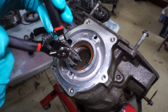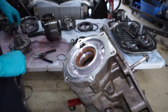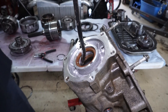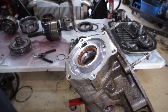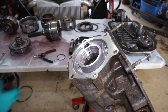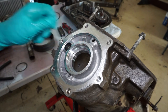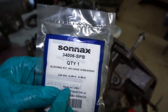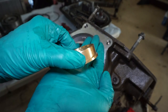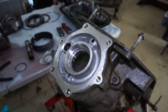All right. First thing I'm going to do with the case is do this rear seal. I got a big snap ring in here so I'm just going to take the snap ring out and work on getting the seal out. I'm also going to be doing the bushing so I'll tap that out right away. The bushing we're using is an anti-walkout bushing and it's going to have a roller bearing on it. So I did take this to the car wash and got it sprayed out and cleaned off. We also did a set screw in the reverse hole on the case — I wanted to wash it out because there were some metal shavings from tapping.